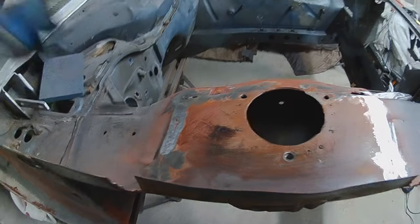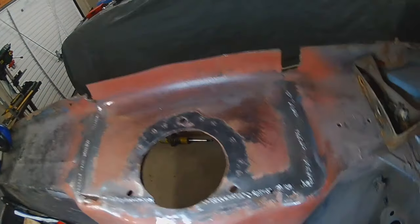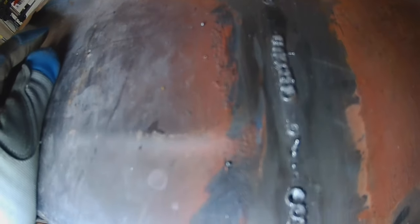I'll go over it with a welder and we'll see how it comes out. As you can see, once the plate's been welded in, I've gone round again all the areas that have just slightly been missed, or when you grind it down it brings a little line where the two plates join up. You just go round - see, this hole needs filling, this hole needs filling, that hole needs filling - and you just grind it down again and see what you're left with.